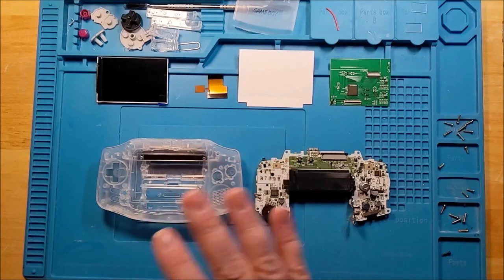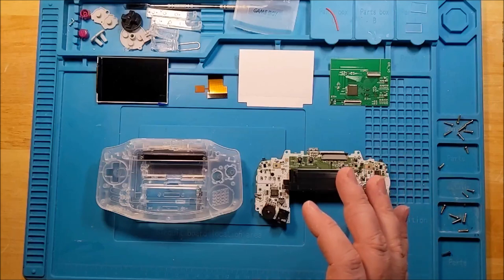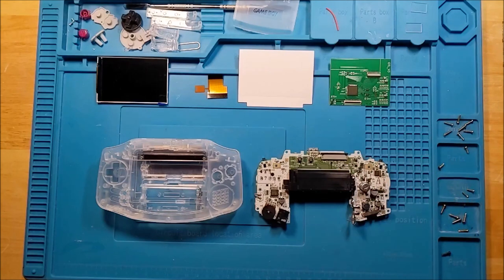The IPS ones now are simple because there's a ton of pre-made shells for them. But the IPS ones are still a bit of a thing. They're big and they take a lot of power. So somebody else, I think pretty much the same people who made the previous one-chip models, like I have one for one of my Game Boy Pocket screens, that's actually a low power draw. And so it actually works pretty well with flash carts, for example, and even rechargeable 1.2V batteries on a Pocket. So yeah, there's some stuff to be said for this.